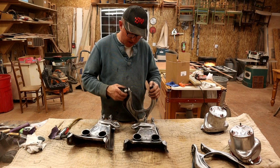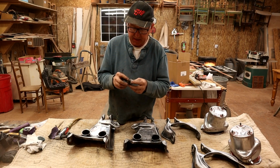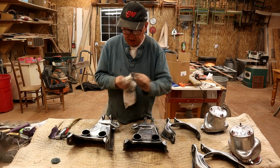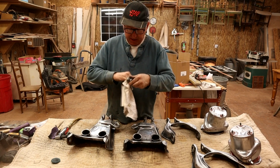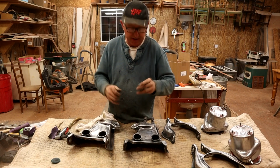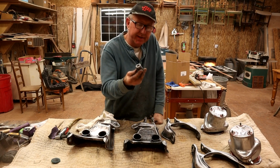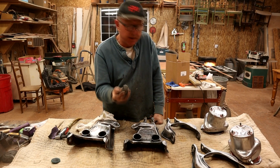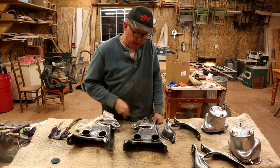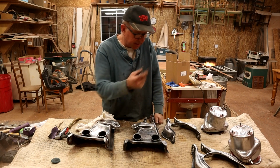I'm thinking that most of the wear or the play is within this nut, which I think is softer material, or more wearing material. This takes a lot of the wear. The reason I think that is because on these new ones I bought, I used those new nuts that came with it and put them on the old ones, and there was no play. So all of the play seemed to be in these bushing nuts. So anyway, I'm going to buy 4 new ones for the upper control arm and see how I get on, because the thread on those pins at the top seem to be really good, and they're not cracked or anything. So again, save some money.